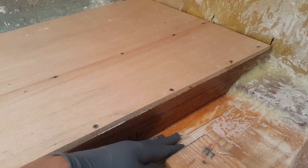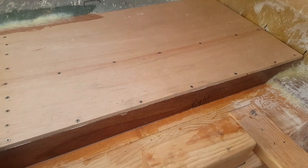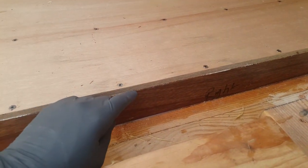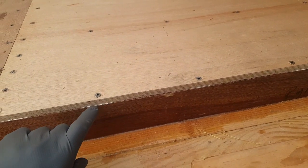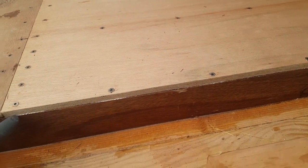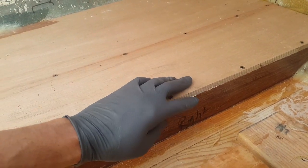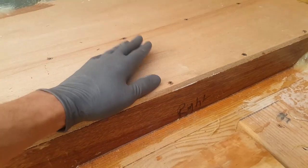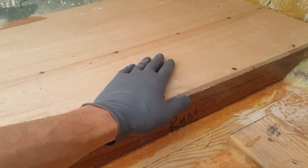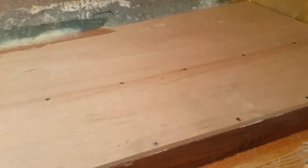And then we'll need to sand down a little bit around these edges to give something good to stick to for that epoxy. You'll see little pieces of the marine adhesive that kind of spilled out, so we'll take an X-Acto knife and clean out those little spots. It'll still go right over the epoxy well, it's just it won't adhere as well. That little area could develop some air pockets, so it's easier to just get in there and yank that piece off. It's just a little bit.